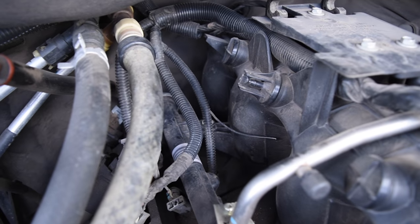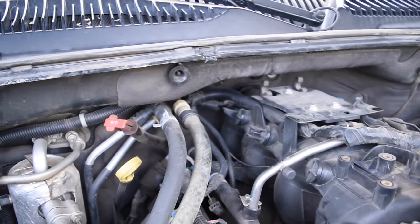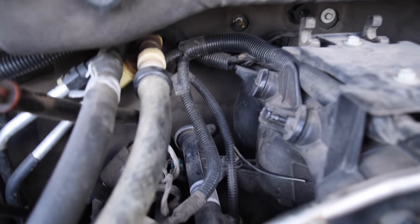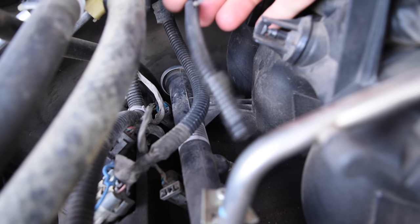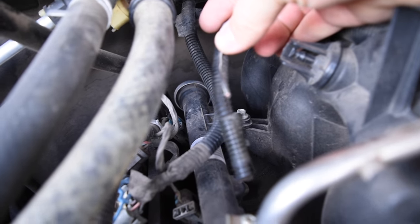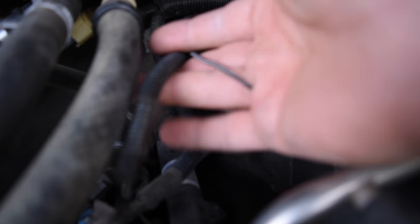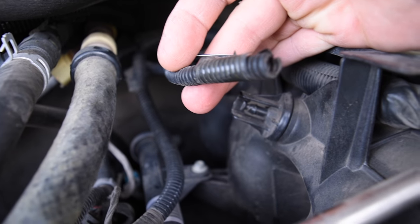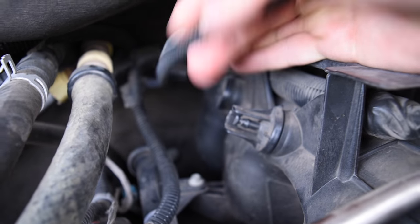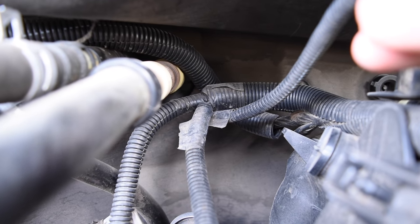As I mentioned, I went online through a couple of forums and videos and was able to determine that this could possibly be causing the issue — it's this single little ground wire connected coming out of this harness that goes to the back of the engine block. It's one wire inside this wire-protected molded casing. I barely tugged on it just to see if it was connected, and it broke loose — it was that corroded.